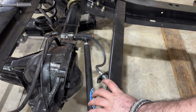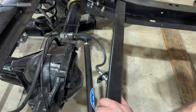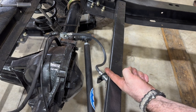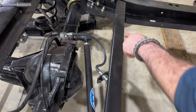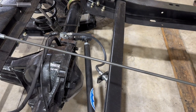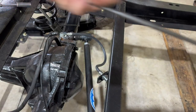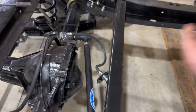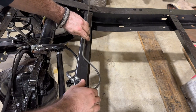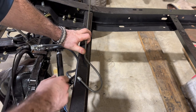What we need to address for our brake lines is a little tricky. The routing of the brake line for the rear ties in and makes basically a 180-degree bend where it comes out and then shoots down this cross member here. I'm going to be using these lines — they already come pre-flared with fittings on either end. So we're going to work with these and work our way forward. This should be pretty close as far as making it fit in with this soft line.